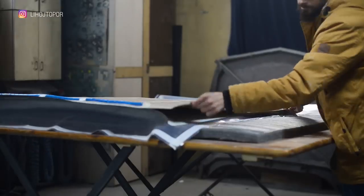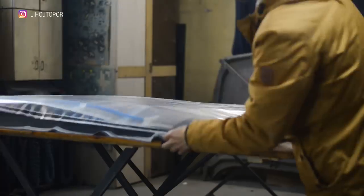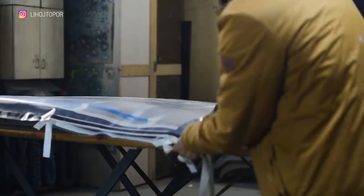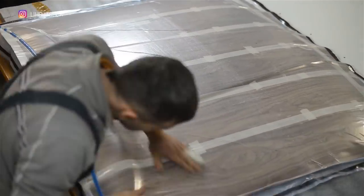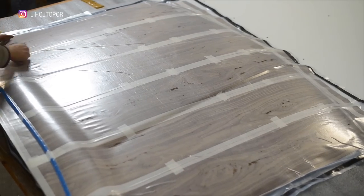We put the veneer on the resin and on top of the film, and now it remains to join the upper film with the lower one. As you can see, everything worked out great. The film presses the veneer over the entire area, and Andrew checks and helps with his hands in the bending points.